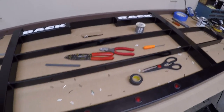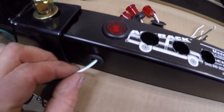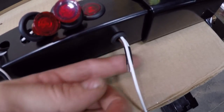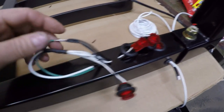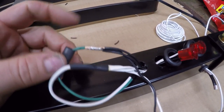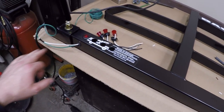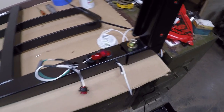Now wiring the lights into the rack — I know it looks like a mess up here but trust me, there's method to the madness. I started out by putting some rubber grommets in these half-inch holes on the bottom to protect where the wires pass through. I have the running lights wired in right now — all done. Another grommet out here protecting the wires where they come out this side. Right now I'm working on the three brake and signal lights on the right side. You can see good soldered connections with shrink tube ready to go — seals it up really well. No scotch locks or crimp connectors here, I like to do it right.